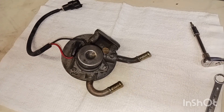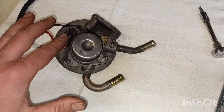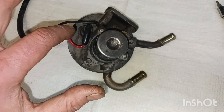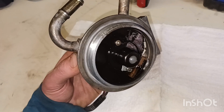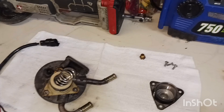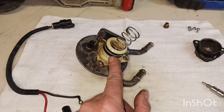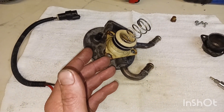Once you've got it on the bench, go ahead and remove your bleeder screw, then unplug the harness for the fuel heater. The grounds are on one of these T20 Torx screws — take out those three Torx screws. Note that on the bottom there are two more you'll want to take out as well. Once you get that off, always make sure the inside is clean and smooth. These right here are your plunger seals — a lot of times those are what dry out, get brittle, and that's where you're starting to get a leak from.